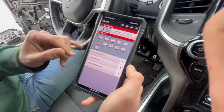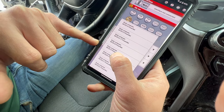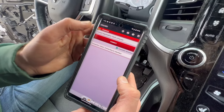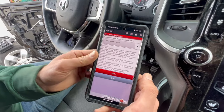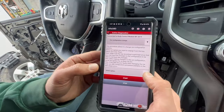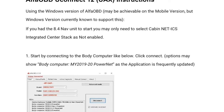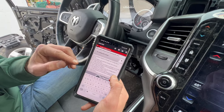From there, you check your RAM in the app and go to Body Control Modules, then Body Computer — for a 2019, it's under Power Net. Check and connect — once you see 'Connected,' go to Active Diagnostics, find Configuration Change, press it, and select the options from the menu. You can use the search bar to find the right settings, and there are pictures in our description of every menu you need to navigate to get to the right place.